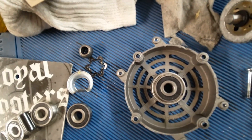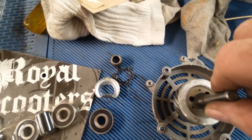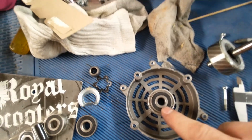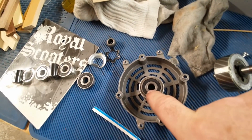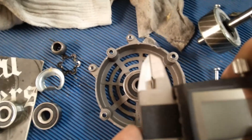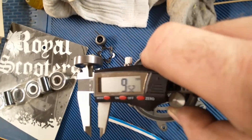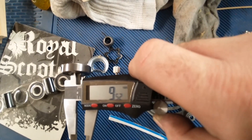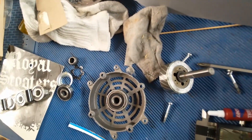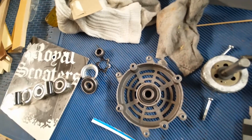The problem is the shaft is just slightly smaller than the bearing's inner diameter. The bearing is not actually 9.5 millimeters — it's 9.52, which is slightly bigger than 9.5. Those two tenths make a difference when you're trying to get a snug friction fit so it doesn't rattle.